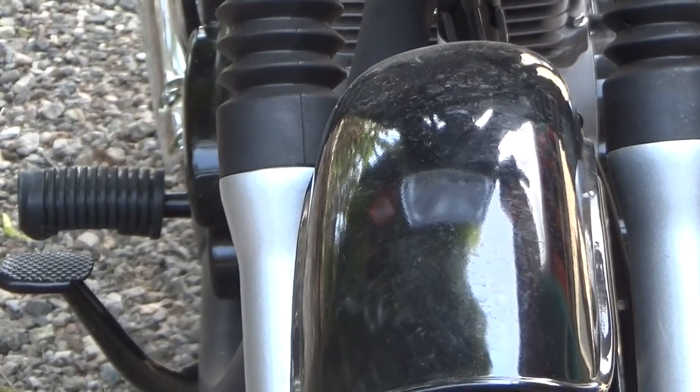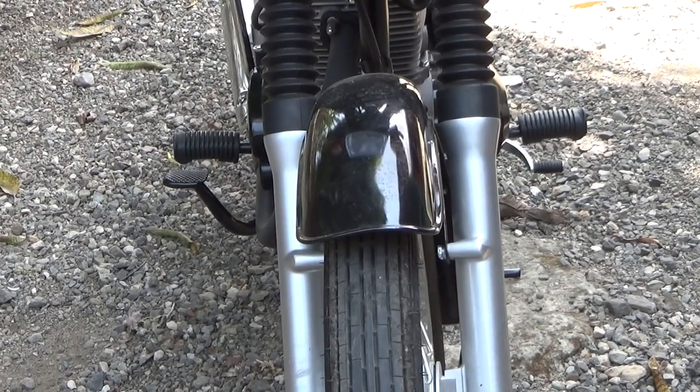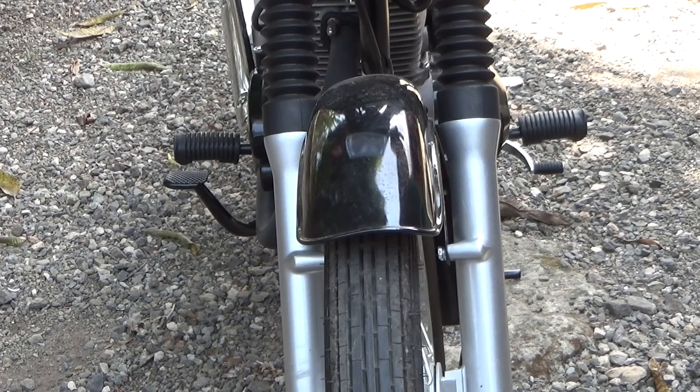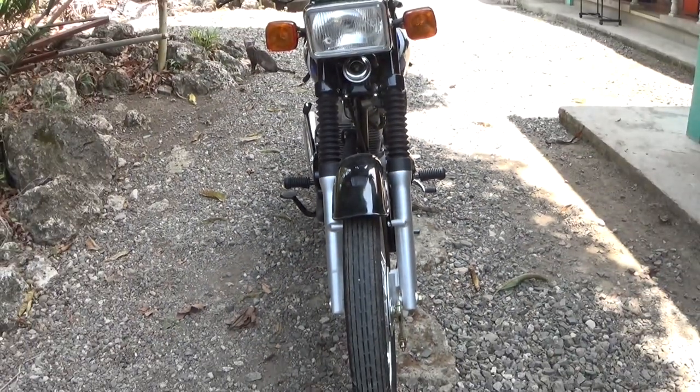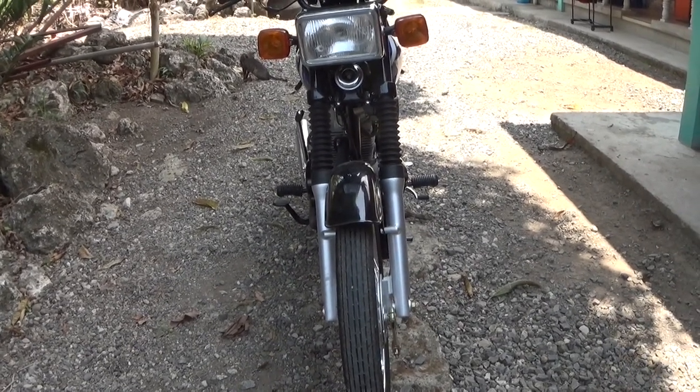and I had attempted to straighten that out a little bit before, but it appears that some of the mounting bolt holes are not lining up very well. And unless there is some other underlying cause, I believe slotting the holes on a couple of the mounting screws is going to be the best way to deal with that. But I'll really need to take it off completely in order to find out what's going on and make sure I'm not just hiding a problem rather than actually fixing it. So, let me grab a few wrenches and see where I can go with this.